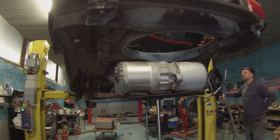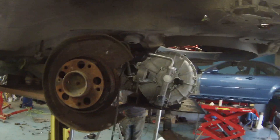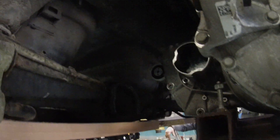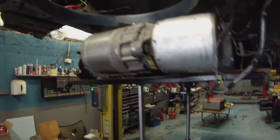So this is the first trial fitting of the Tesla motor — we're putting the motor and the E34 rear end into the E31. We've pretty much got it exactly where we want it to be. We don't think we have to cut out any more other than the spare wheel well here — just need to check our measurements.